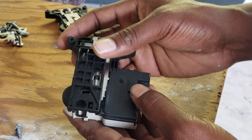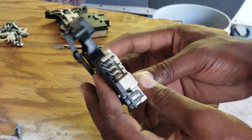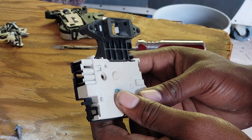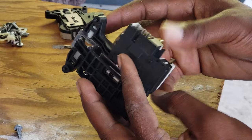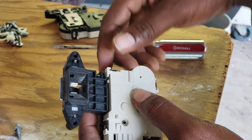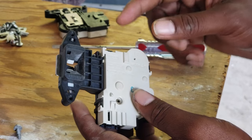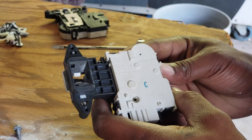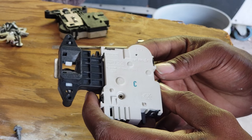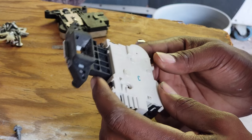Reinstall it back in your machine. If you don't know how to get it off, take the lid off the top of your washer, open the door — there are two screws right by the switch — unscrew those, reach in, and pull it right out, unplug and remove. If your machines are stacked on top of each other, you can remove the tub seal and reach in with your hand to get it out that way too. Any questions, feel free to leave them below — I usually respond within 24 hours. Don't forget to like and subscribe. Thanks for your time, and say bye, Blue!